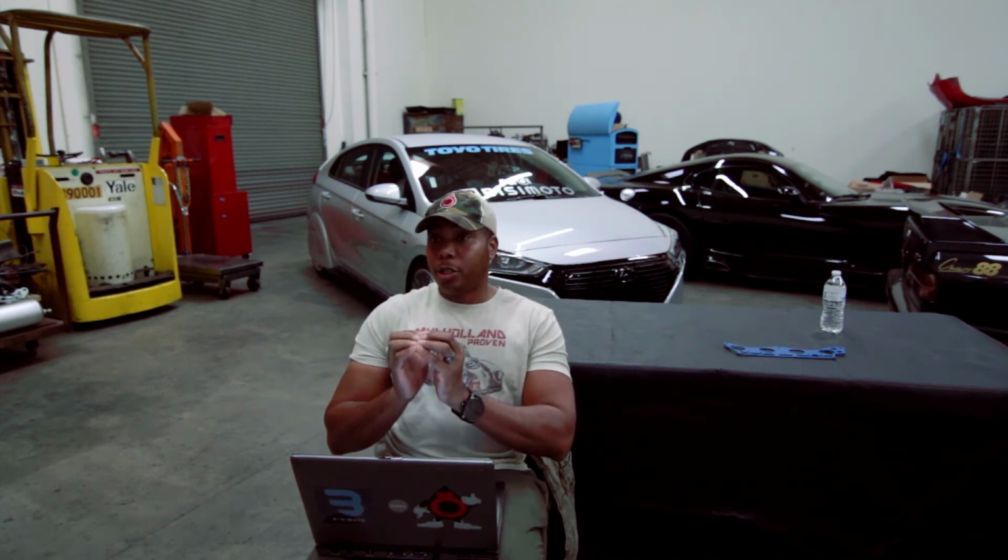What I mean by that is, because of piston to head interference, when you're building an aluminum rod engine, you do not use the same clearances as you would with steel. Many of us can build flat 6 engines, inline 4 engines, inline 6 and V8 engines with a 30 thou piston to head clearance using steel rods. Don't dare that with an aluminum rod. The aluminum rod, depending on the weight of the piston at the end, could be anywhere from 50 to 70 thou piston to head clearance. And yes, you may think, oh my goodness, that's quite a distance, but when the aluminum heats up, it does tend to expand. And when it does expand, it gets you to the ideal static compression that can allow you to have a very good dynamic compression ratio to allow you to make good power.